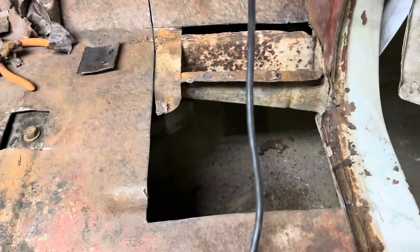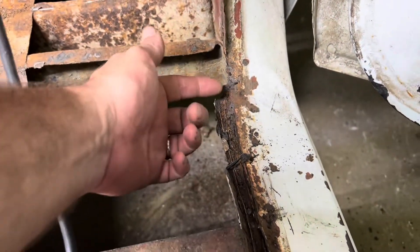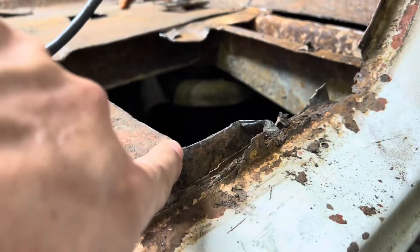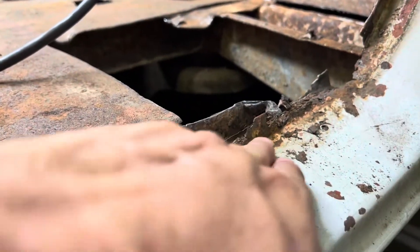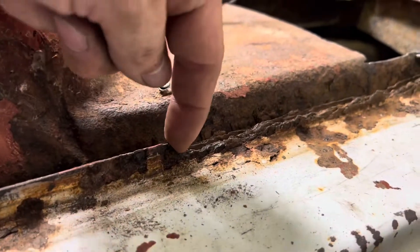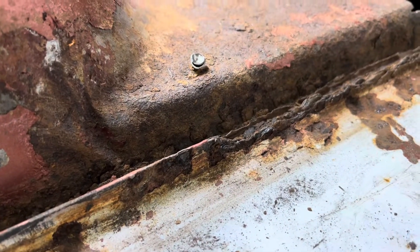I had to get under there and look. I have enough metal right here on the inner rocker steel - I'm just gonna cut this down to here, then grind all this smooth and level, and then come back here and do the same thing, and tack in some kind of a piece of metal right there.